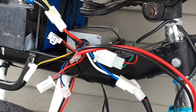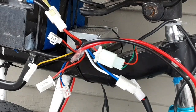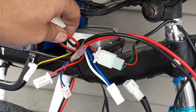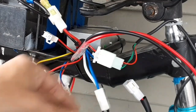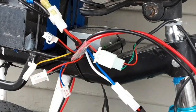Here's the part where you could screw up and blow up the control box — read very carefully which way the bigger wires go. There are two sets of really thick wires: the black and red come from the battery into the control box, and the blue and white go out to the motor. So we'll hook the motor wire up to the motor clip.